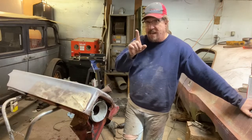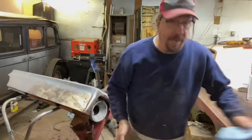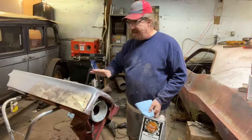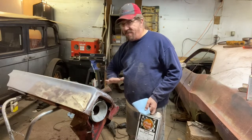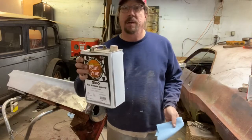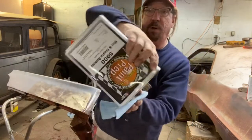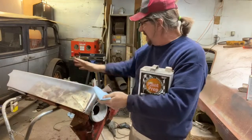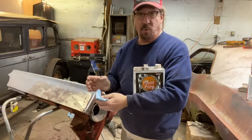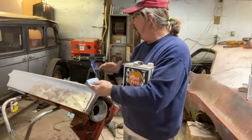One other tech tip I want to give you, and we may make this a tech tip, but I want to put it in here because it was something I did earlier and I didn't talk about. Sometimes I do things without thinking, and I kind of did that here before after I covered the cars up. I went and wiped this whole thing down with Prepsol to get the last of the strippers off. It's a common mistake that I see people do. They'll take their rag, put it right over the Prepsol can, dump it on the rag, wipe it down, and then come back and get more and do this. Don't do that. You're backwashing your contaminants from what you're wiping down back into the can. If there's any oils or silicones that get off onto the rag, it's in your Prepsol, and your Prepsol's crap. You're going to end up forever chasing fish eyes in product.